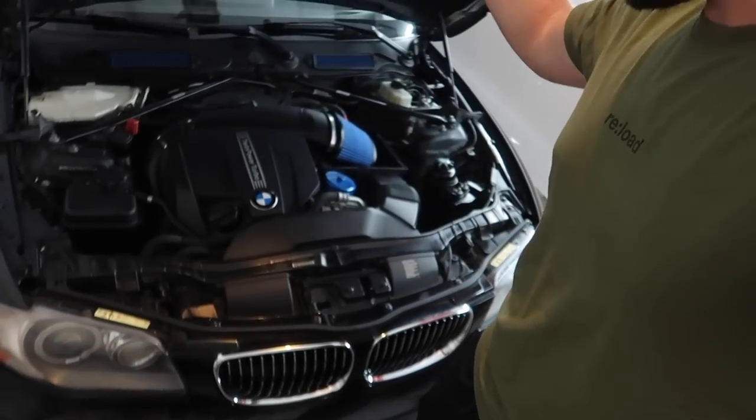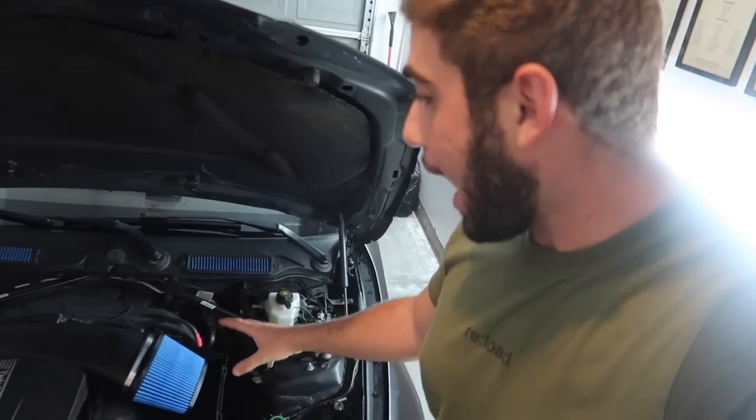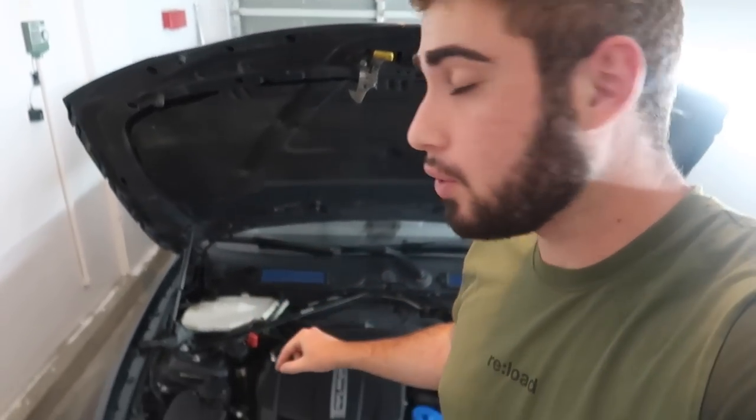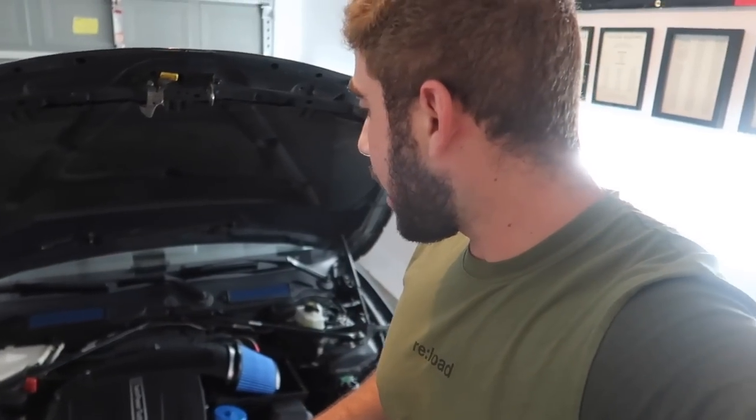What's going on guys? Welcome back to Choco, back to another video. In today's video we're going to be modifying my wife's 135i even more. We got a dash cam in the car so now she's fully protected. We got a couple bolt-ons in the car which looks absolutely amazing, and we have some more coming. You guys saw in the last video we blew out our charge pipe after we installed the JB4 tune, so we're going to need an upgraded charge pipe. We're probably going to upgrade the intercooler and maybe even go to MAP2.